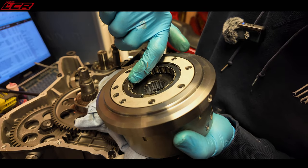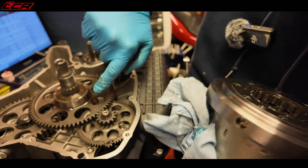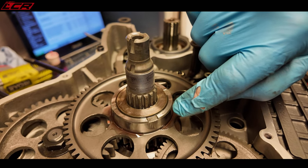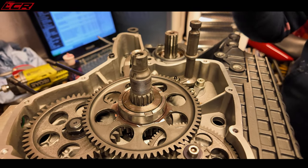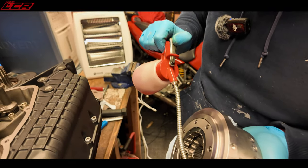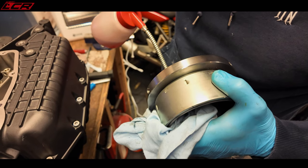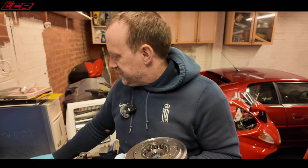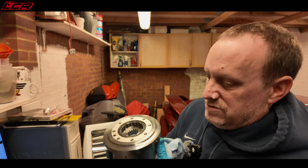Just the sprag now. The sprag in here is really nice. What you check for is flat surfaces on these little rollers - these are the bits that tell me it's in good condition. If it wasn't in good condition there'd be little flat marks all the way around where it just bites, bites, bites. You can see this is a low mileage engine. When you get a Ducati that doesn't start - just spins and spins, or clunks and spins - usually it's this.